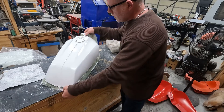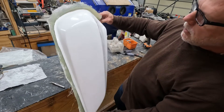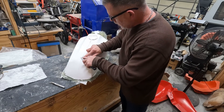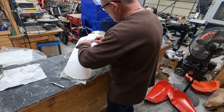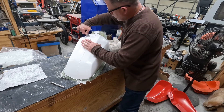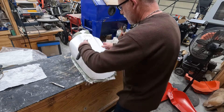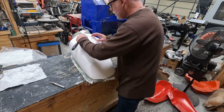Here is the flashing that's left on the mold or the part once it's done. All in all, great shape. At this stage, I use this tool so I don't scratch the surface — I run through and clean these off. These are like razor blades so you have to be really careful. Just go around and pop this off. Voila — then I take the edge to knock off any of the sharp edges.